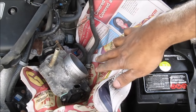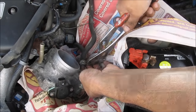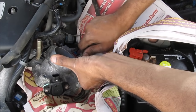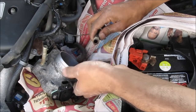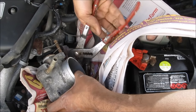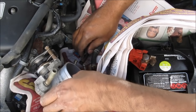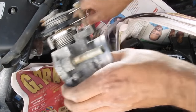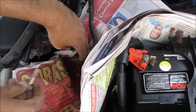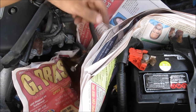I've got some newspaper positioned to capture any coolant that might fall out. I'm just going to back off these clamps and then break this free. A little bit of coolant spilled out — not too much. That's a lot of coolant coming out. You can jam one of these screws from the throttle body in there to stop more coolant from coming out.